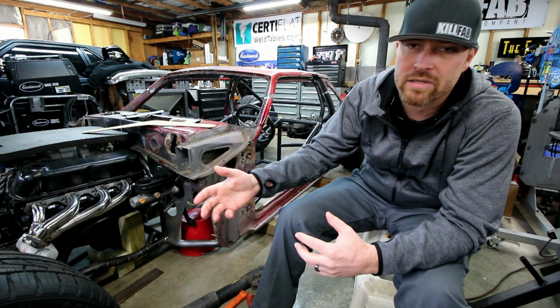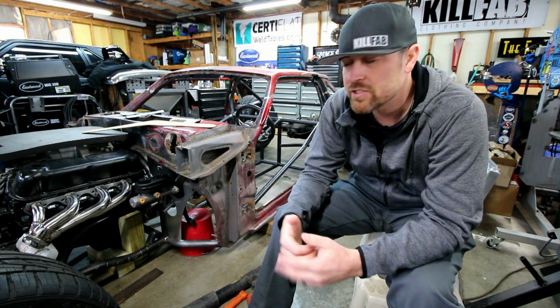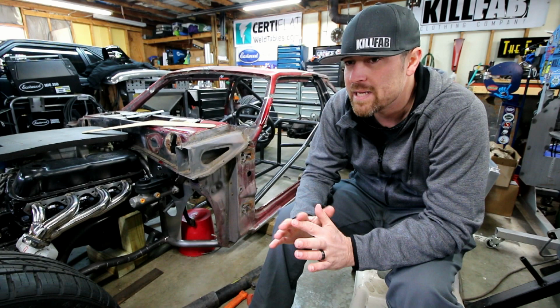Cantilever up front. The problem I'm running into on this is I really want to hang on to the struts. I don't want to do a double wishbone. So doing the cantilever setup as you normally see it would be tough with the strutted suspension. I like the idea of doing something like that, and I may end up using that sort of cantilever on a future project. For this thing though, I really want to use as many Fox body parts as I can. That's the idea. It's a Fox body hot rod.